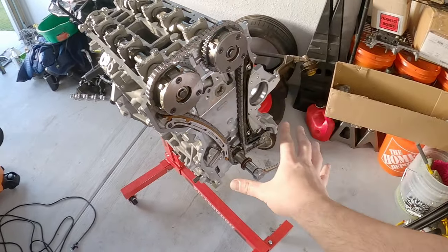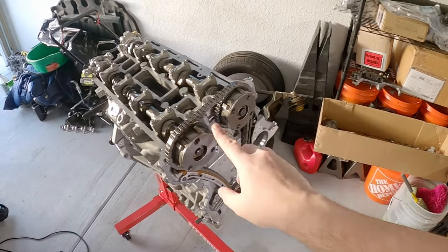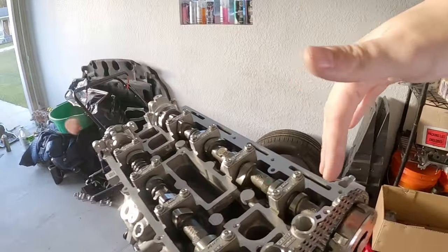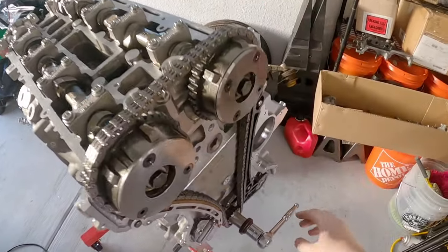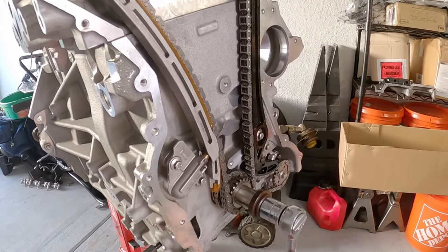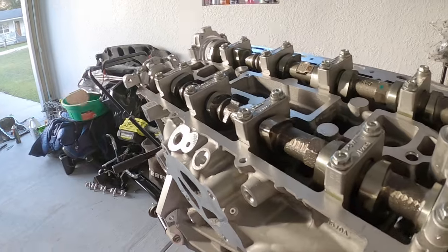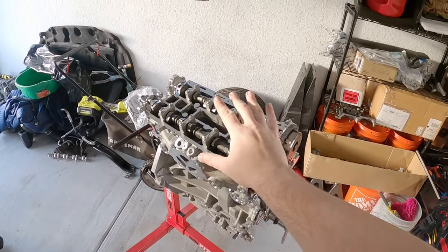It's even the next day. Sorry, my GoPro died and I had to get some work done last night. Unfortunately you did not see the rest of putting everything back together and getting everything timed, but you weren't missing much — basically you just turn a few things, say a few cuss words, and then it gets done. The good thing is all of our timing chains and everything are on, guides are on, tensioners on, everything's torqued in place, cam caps are fully torqued, I got sealant on both of these, everything's where it needs to be, and it should be in the correct time. I can spin it over here and see everything just spins together all nice and easy — so nice. That much is done.